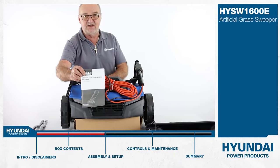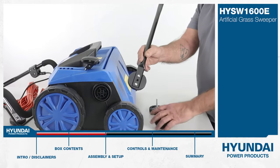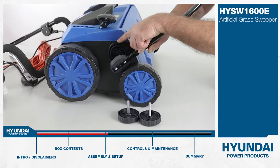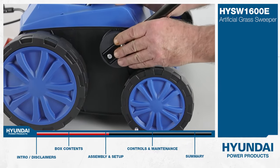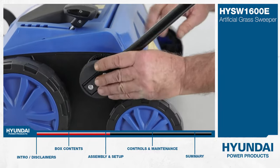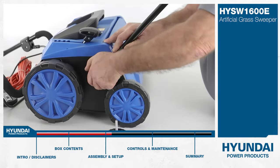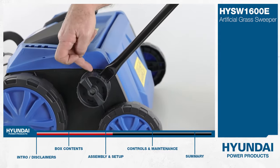I do recommend that you read the user manual thoroughly before use. There are two lower handles — they are identical, it doesn't matter which one goes on which side. You'll see these large black hand wheels, one goes on the left and one on the right. There are little arrow indicators and alignment marks on the top. You can put the lower handle at various heights, and these little serrations lock the handle in the most comfortable position. I'm just going to line up the top two marks and fit the hand wheel, screwing it into place. When I fit the one on the other side I'll make sure my notches line up on the longest mark.